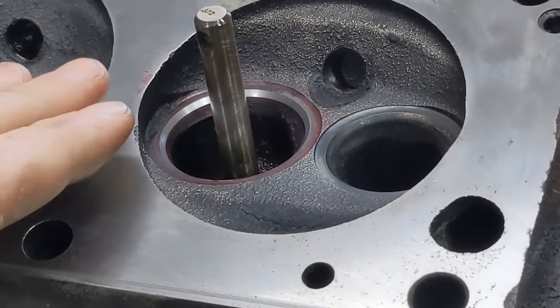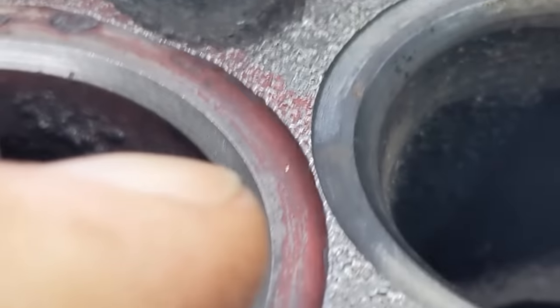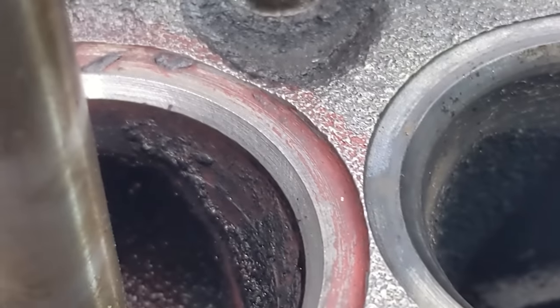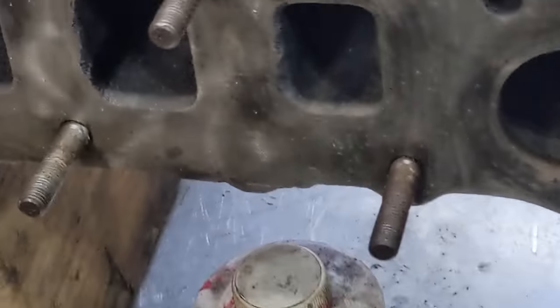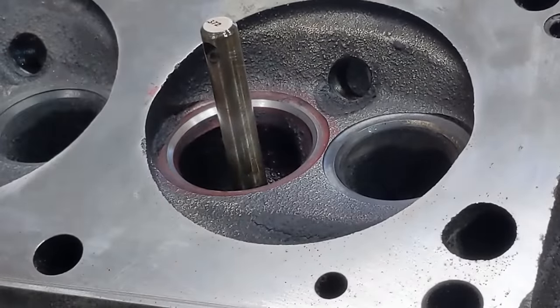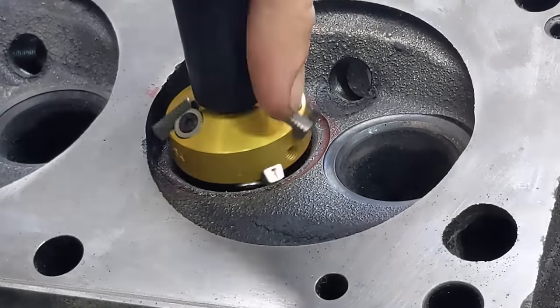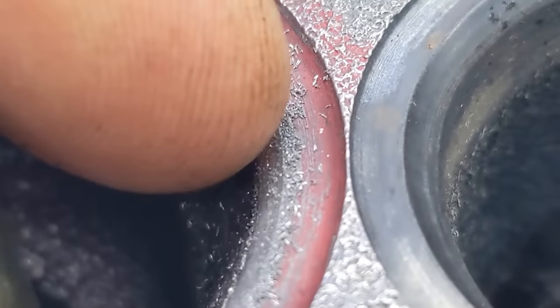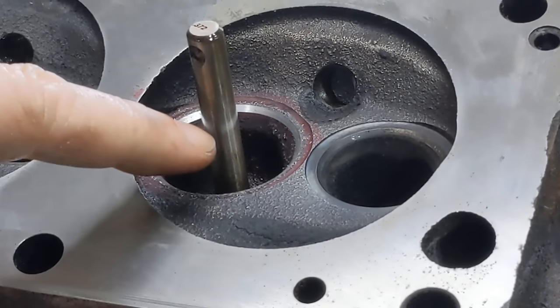The key is to go slow and take your time. You can see it's a little discolored right there — that one is mostly gone. Otherwise it looks pretty good. I'm going to go maybe another time around just to try to get that out. That is also right at the edge of the seat, so it might get removed when we do the inner angle. You can see it's clean, and you can see all these little shavings — those are the cuttings coming off of that seat. So our 45 is now cut on this.